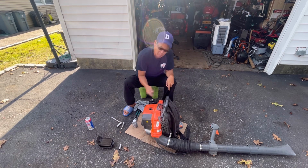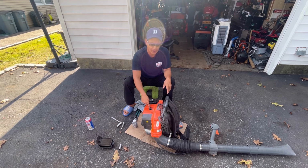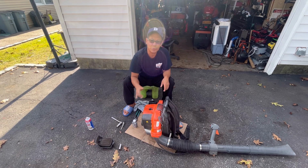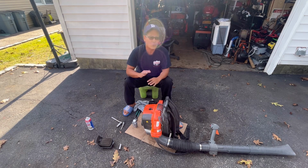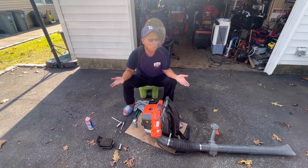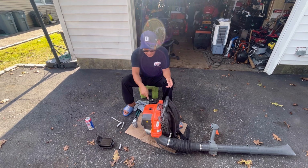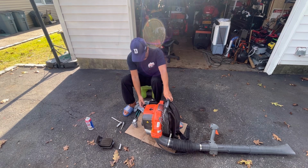That's the black wire. So I disconnected that, put two-stroke oil in there, started pulling, and it turned over. It went brrr, like that. Although not very strong, just brrr. And then trying it again, no dice. So I have a feeling the bore is scored and it's not getting any good compression unless you put two-stroke oil, just a dab. So I just did it again, and I'm gonna try it again.